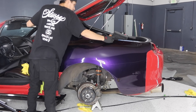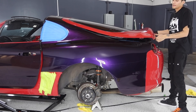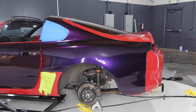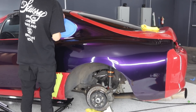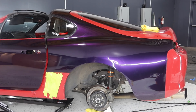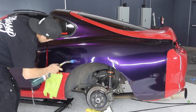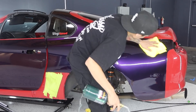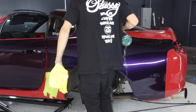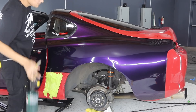Just like that, we have the quarter panel finished. This was one of the hardest quarter panels that I've ever wrapped, just because I had to wrap it wheel to wheel — meaning that I had to wrap it over the roof in one piece. The total coverage on the vinyl was 11 feet, so it was close to four yards, when most quarter panels and doors are about three yards or so. The most challenging part was wrapping it over the roof and making sure everything was in coverage. The exact measurements from the top of the quarter panel to the back of the quarter panel was about 58 inches, so I only had about an inch on each side to play with. It was kind of tricky, but at the end of the day we ended up getting it done and it looks super good.